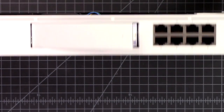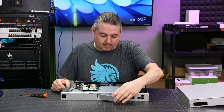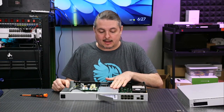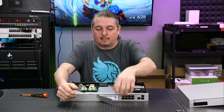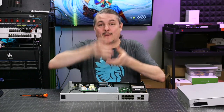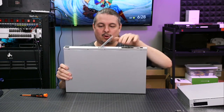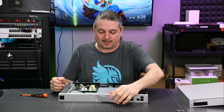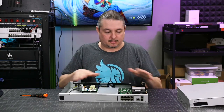Here's the hard drive, which snaps in and slides out. One thing to be careful of: you can actually push it in too far. It's seated fine at the back, but then the door won't close because it's past the spot you're supposed to grab. You can slide it back out if you make that mistake. Push it in until it starts to stop — that's it. If you just drop the hard drive in while the device is in an odd position, it can go right past. It feels well made, it's metal, slides in and lines up the rails.